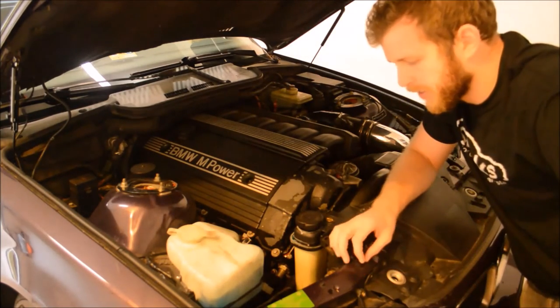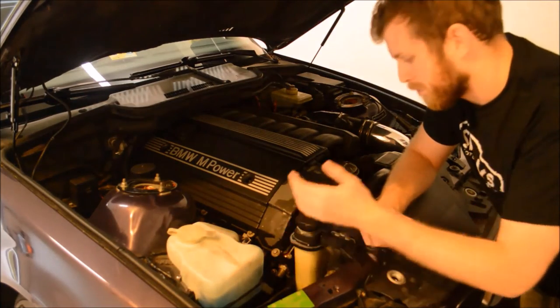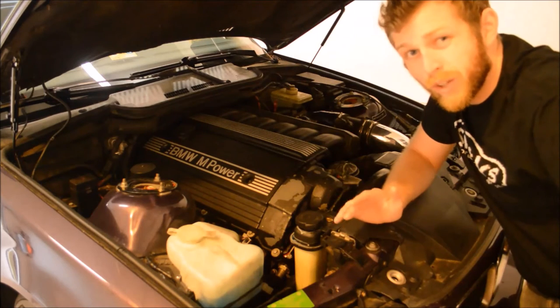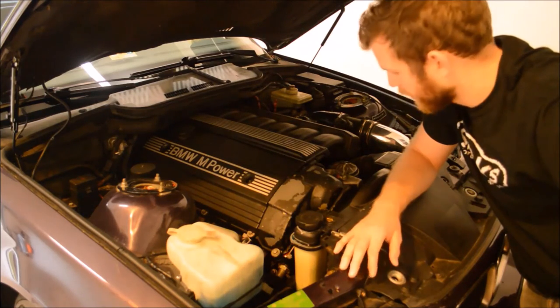Your first time driving, you'll probably take it out and come back and find that your coolant level has dropped some. That's typically when some of the air has escaped, plus you've opened up your thermostat, etc. Make sure you follow whatever directions for your car online. They're very particular instructions for some vehicles.